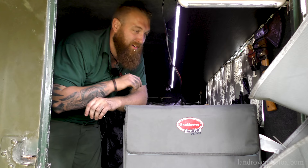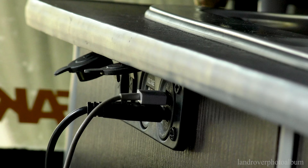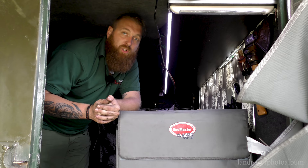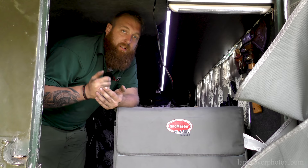The next job is I'm going to have a little Anderson lead just down the bottom. I've got a totally separate battery system for the rear of the vehicle — I'm running a Merlin split charge system, so as soon as I turn the ignition off the cranking battery is isolated. By doing that, I can do whatever I want for as long as I want in the back and know it's always going to start.